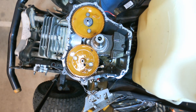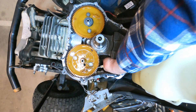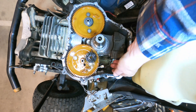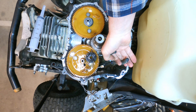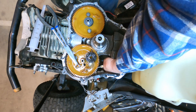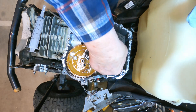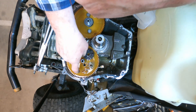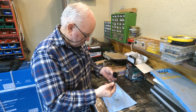The sump is pretty well drained out and I can see the governor gear — I'm going to try and reach in there and get it. There's part of it, and here's another part. I'll need my long nose pliers to get to it. The trouble with these long nose pliers is they don't close real tight on the end. There we go — there's another part of it. There are a bunch more parts in there somewhere. I think we're going to take these cam gears off and get in there with a rag and mop all that out. So far these are the only pieces of the governor that I've recovered.